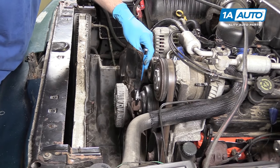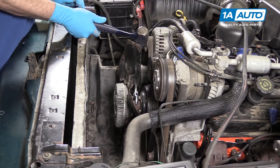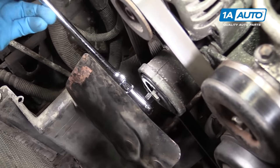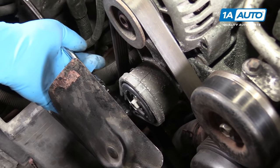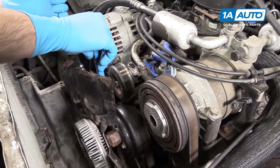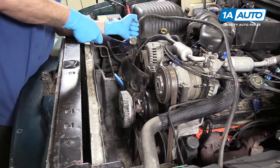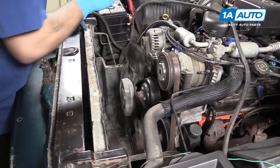We're gonna use an adjustable wrench — though an opening wrench or pipe wrench would work as well — and place that over the clutch fan nut, then strike it quickly with a hammer. Using the drive of a 3/8 ratchet or breaker bar, go into the slot on the serpentine belt tensioner and rotate it as far clockwise as we can to put extra tension on the belt and try hitting the wrench again, as this should keep the pulley from turning. Once it's loose, you can remove your ratchet and spin the clutch fan off.